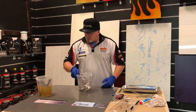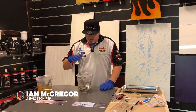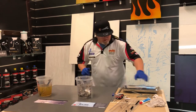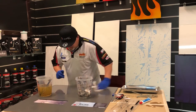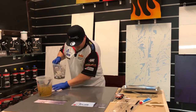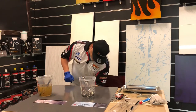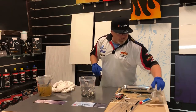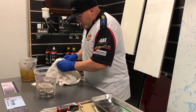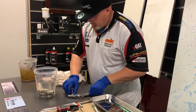Okay, here we are at stage two. Just to recap: I pulled the gun down, put it in our 202 dip and strip, and neutralized it with our M10. Now we're going to go about putting the gun together. Just before you start, there's no point doing this whole thing if you're going to drop your gun in amongst any dirt or leftovers from your dirty gun, so keep your workbench as clean as you can and get a fresh rag. The gun is fully neutralized — you're starting off with a clean canvas.